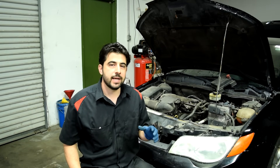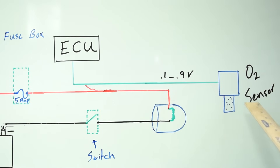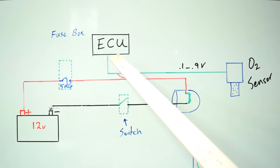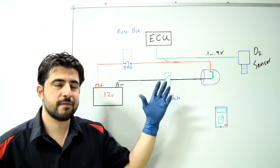Now, where a positive to positive short is more likely to give you issues is when a positive wire is shorted to a signal wire from a sensor — so let's say for example this O2 sensor. An O2 sensor usually sends out a varying signal between 0.1 to 0.9 volts through a signal wire to your ECU. If you have a power short to the signal wire, you're simply going to get 12 volts sent to the ECU. This usually doesn't damage the ECU because the signal wire is not grounded at the ECU — rather, you should think of the ECU where it meets the signal wire as a multimeter that measures the voltage coming from the O2 sensor. But if that happens you're obviously going to get a false reading and you're going to run into all sorts of performance issue problems with your car.